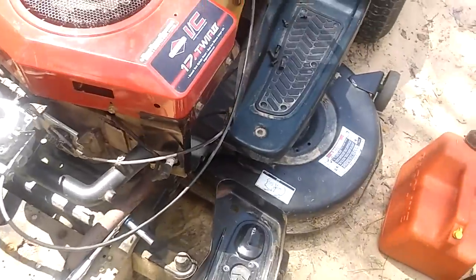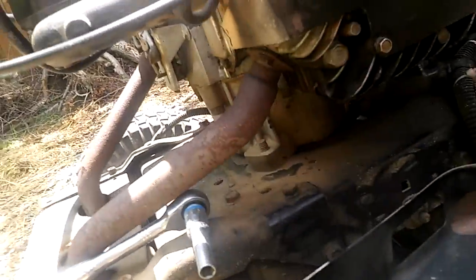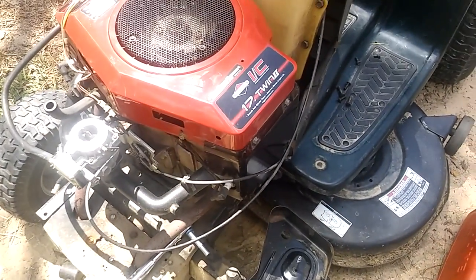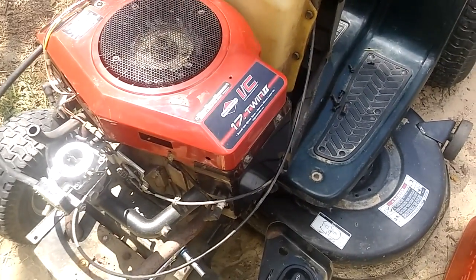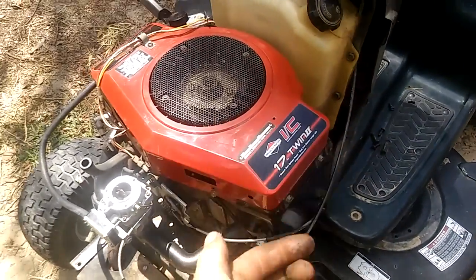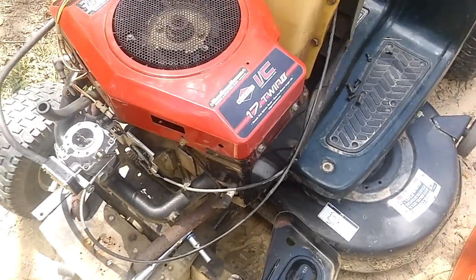The reason it's so dusty is because this cylinder has a leaky head gasket because I broke one of the cylinder head bolts. But I ended up just putting a self-tapping large sheet metal bolt, probably for a car of some sort, into it to stop it from rushing out the hole. But the head gasket is still blown from whenever there was just an open hole, because I broke the bolt on the inside by tightening it too much.